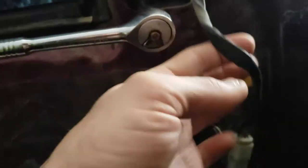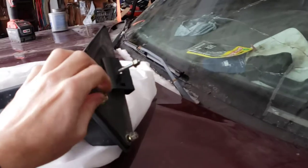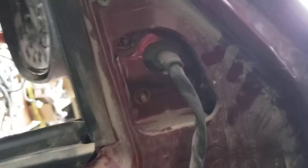To take off the mirror on the driver side, it's a 10mm — three bolts, one, two, three — then unplug your electrical power mirror. I'm switching to a tow mirror off a GM just because I may as well have a nice set of towing mirrors. Nothing wrong with these ones, but what's better than seeing a lot more? So let me give you an idea of what I did. I got the three bolts loose, broke the one nut, and got the wiring unhooked.